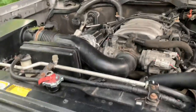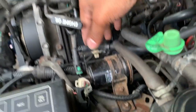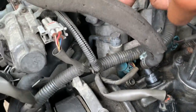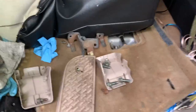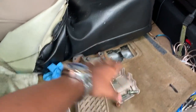I don't have a fuel pressure gauge or a compression tester. The way I confirmed fuel is I took my fuel line off the fuel filter, cranked it, and fuel splashed out. Cranked it again — fuel splashed out again. Then I disconnected the bolts on the fuel rail on each side and did the same test — fuel spilled out. Also, as you can see, I've got the seats moved out, which means my fuel pump was replaced.